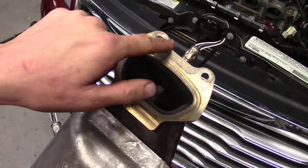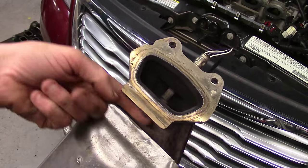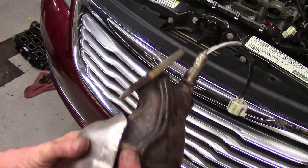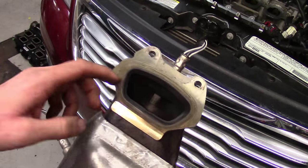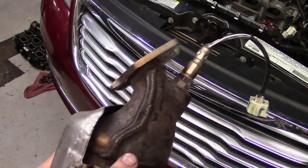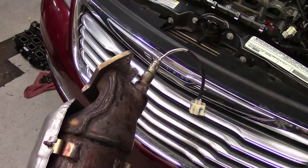You can see the two upper 10s and the bottom two — there are no holes. It's that whole clamping mechanism I'm going to show you in a little while. This actually just sits in and gets caught right here and then squeezed tight. That's why we only back off the bottom two and take the upper two off completely. I'll show you more once we get the cylinder head off for easier access.